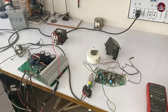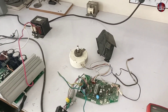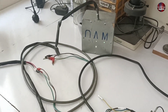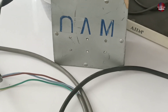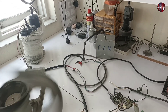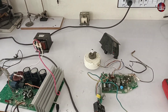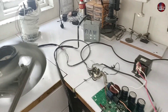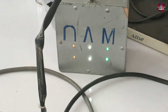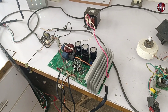Now I have attached the motherboard with the indoor motherboard. All the components are installed. Now I will power on the indoor control board. The indoor fan blower motor has started. The outdoor fan has also started. The analyzer is telling us that the motherboard is trying to start the compressor and all the inverter IGBTs are turning on. I didn't attach the compressor first, to check how the motherboard behaves without it. As it is working fine, I will attach the compressor. Now the compressor is also working fine on the repaired motherboard. The analyzer is working at full capacity and the pressure of the compressor is also okay. It is unbelievable that I have successfully fixed this motherboard.